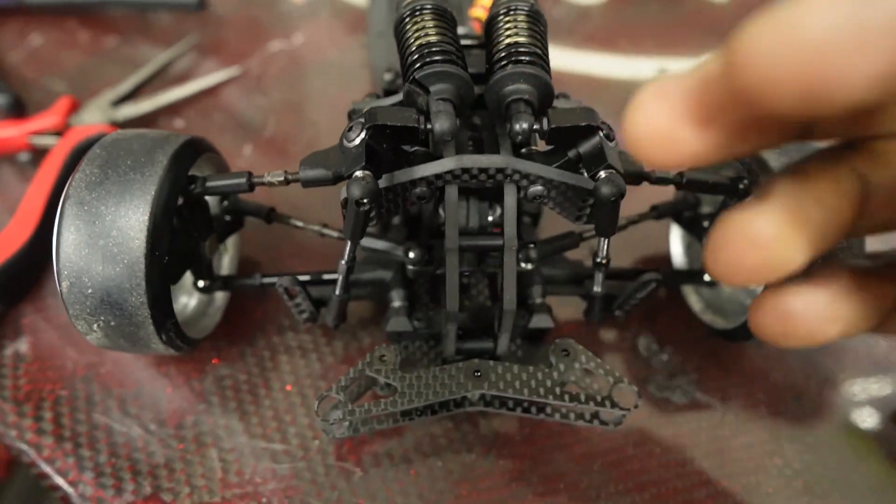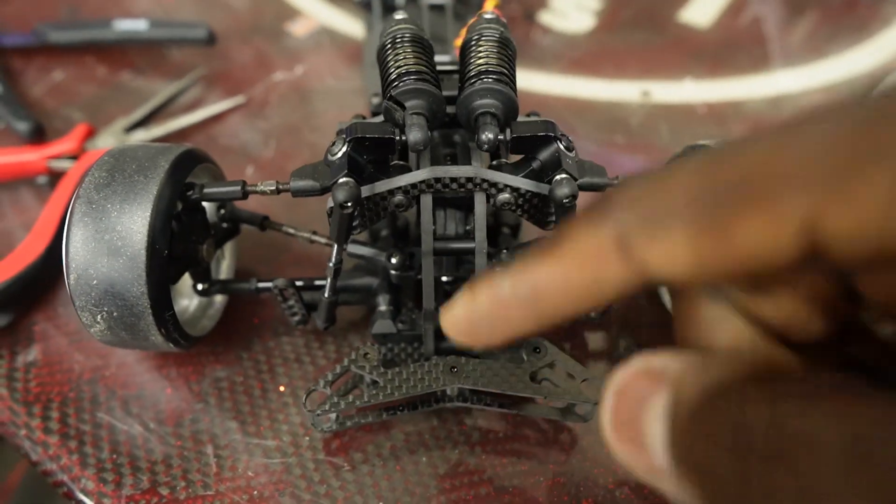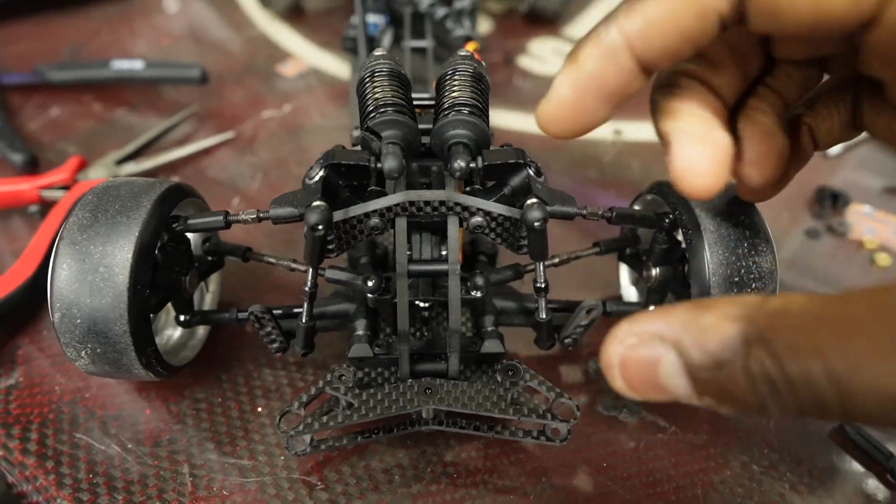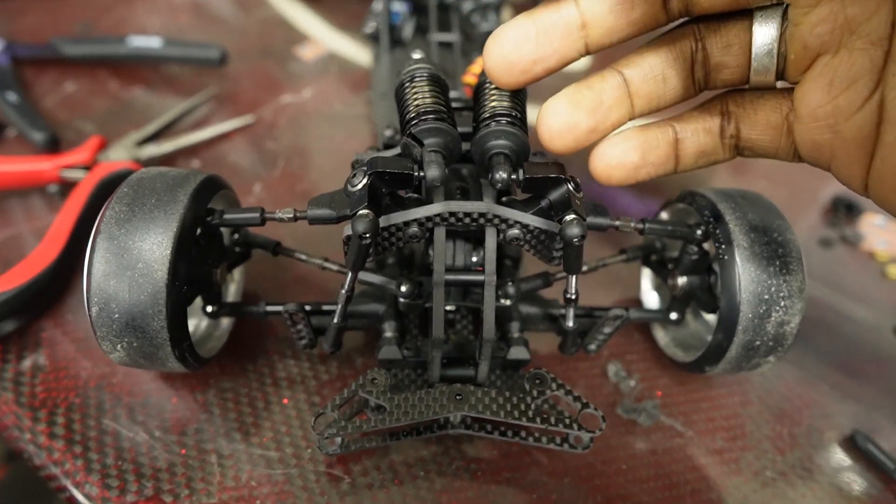That is a key advantage of cantilever suspension setups: your preload is now isolated. You don't really need to adjust it as much because you have a dedicated ride height adjustment via the rod. If your springs already worked with the shock tower setup, they're going to work here — maybe even with less preload. There are cases where switching things over seems to get all out of whack, and that's because there are so many adjustments. The Rhino Racing Shark IFS kit, for example, comes with so many adjustments — the cantilever setup can be tuned to so many different springs because Rhino Racing doesn't make a damper and made it compatible with many.